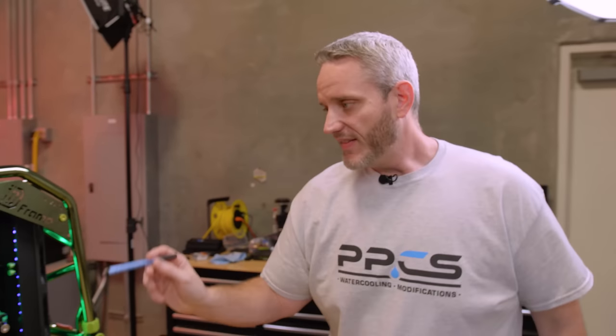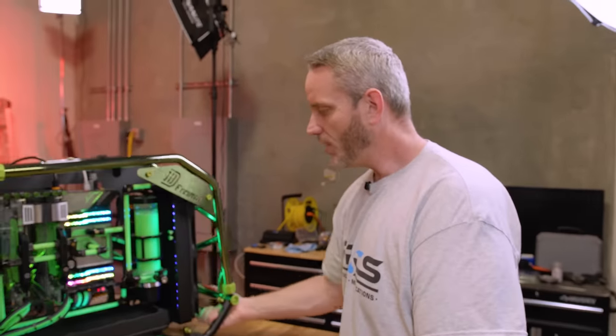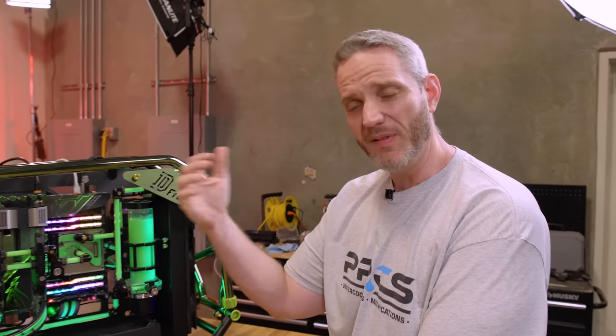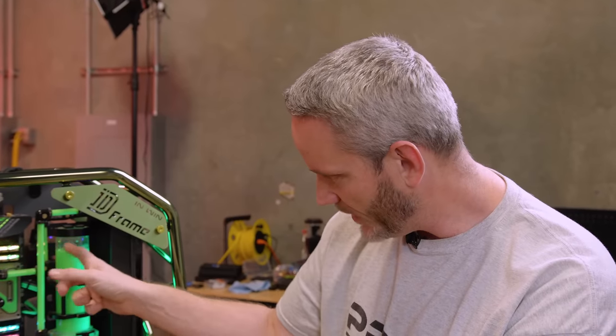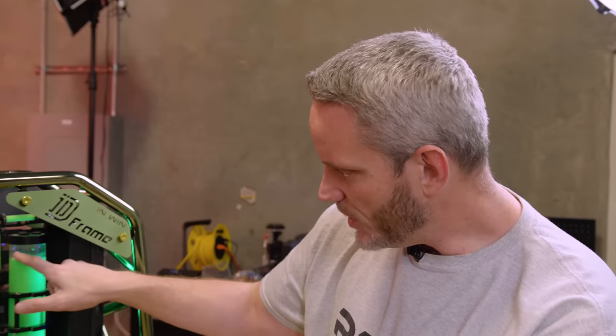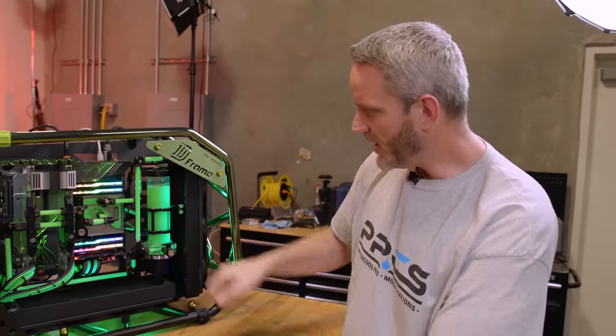Now, to give you a little bit of advice on some things that you can do if it starts to look bad, to start to kind of, I don't want to say heal the coolant, but if it's been sitting for a long time, like I have showed you here, this one came back pretty good. This is sort of ugly up here. Realistically, all I would have done here is top this off with distilled water, because adding that much more distilled water would not have affected the mixture at all. That way you can't see this, which is pretty bad.